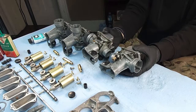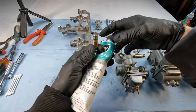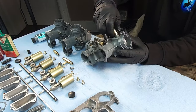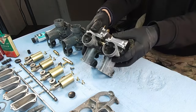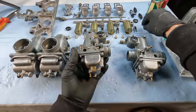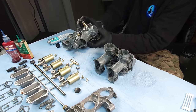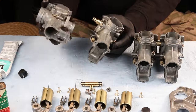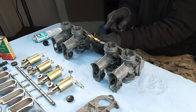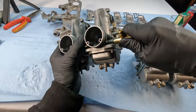Where do we start? Let's start here. We've got these two carbs, the one and the two, and there's a little rubber hose that links the vents together. Grab the brand new nipple, grease it up — that's some moly silicone-based grease. Just grease up those O-rings and jam it in that first hole. Then all you've got to do is line up the two carbs and they just snap together. Same idea for the three and the four — pretty much identical procedure. Grab that rubber hose, that's just a link for the vents. Grease up the nipple and jam it home. Line up the other carb, and if you got it right they literally just pop together. There's no stress at all.